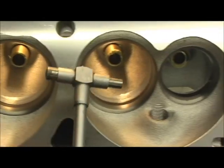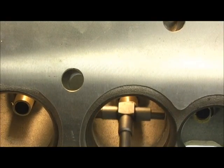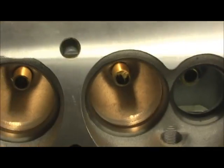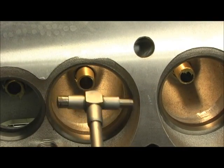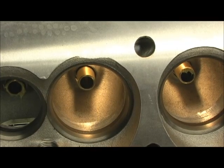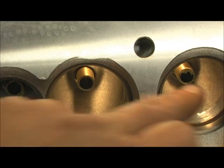Look right here — I can't fit it in. We go over here to this side — look here. I mean, that's just from bowl to bowl. That's not right. That's as much as 20 thousandths difference from each one to the next.